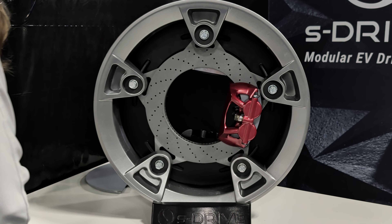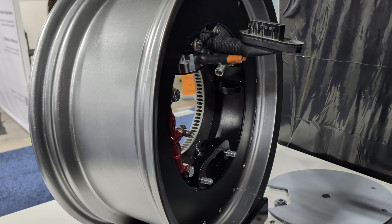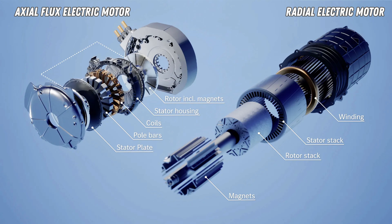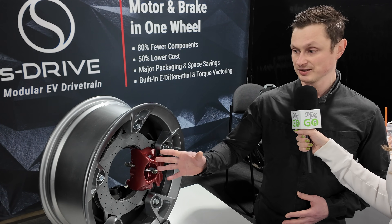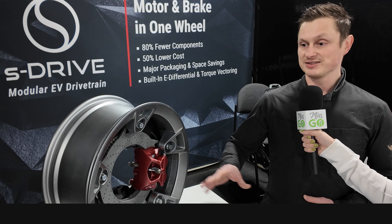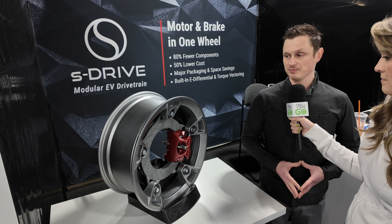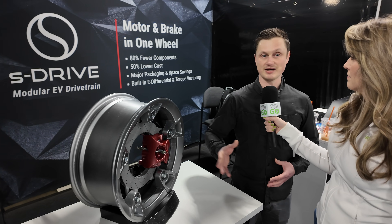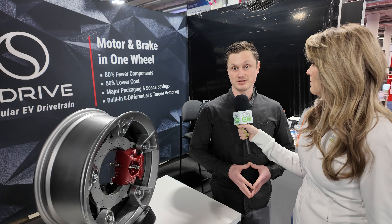This is basically the full drivetrain including the brakes, and it replaces the traditional EV drivetrain. It doesn't have a differential, it doesn't have a gearbox — it's basically direct drive and uses Axial Flux technology. It's a really high torque motor and it's super light. The weight of the system, including the motor, wheel, tire, and brakes, is the same as a car wheel without the motor on a normal generic car. So with this system there is no problem of unsprung mass, unlike other hub motors. We believe we have a product that is truly revolutionary and will change the electric vehicles of the future.